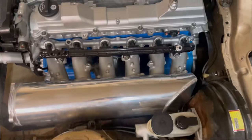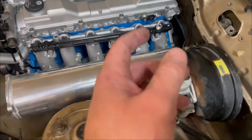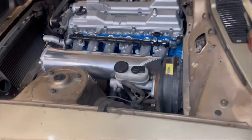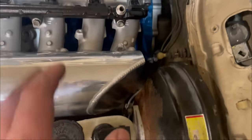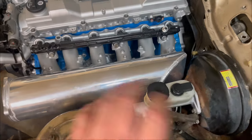So this is my current situation with the intake plenum. The problem was back here where the booster is, and I have adequate clearance now. I cut the end open right here - that was about three quarters of an inch I chopped off at work on the bandsaw. But when I got home and test fitted it, it was much better but there's no way you'd be able to wiggle it out and put it back in. It was still too tight without gaskets, so I knew I needed to do more.